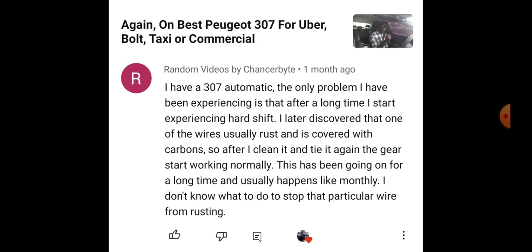Oh, it could be this one, it could be this hole, it could be that hole. No, you have to do one after the other. When you remove a wire from pin one or hole one, cut it off from that hole. You go to hole one of the other connector you want to put in, cut and join, before you go to the next one. So I won't mistakenly take what is supposed to enter hole one and put it in hole two on the new connector.